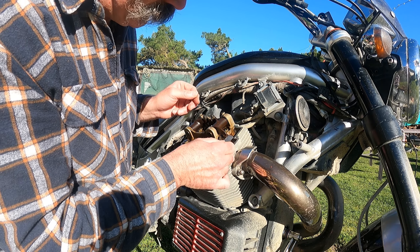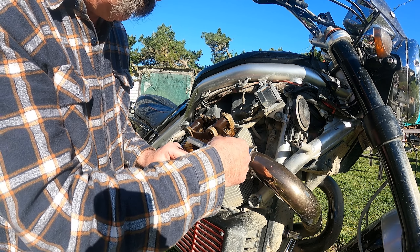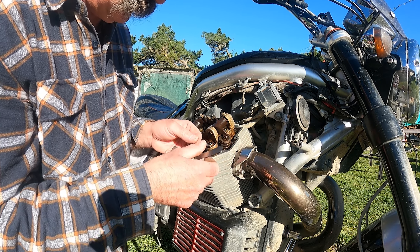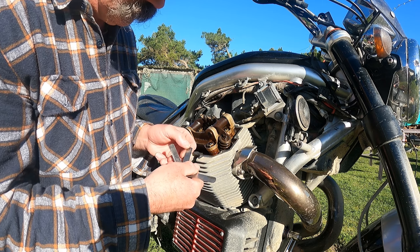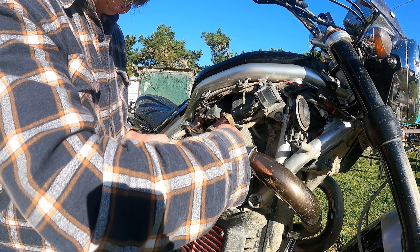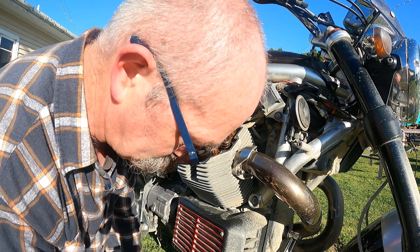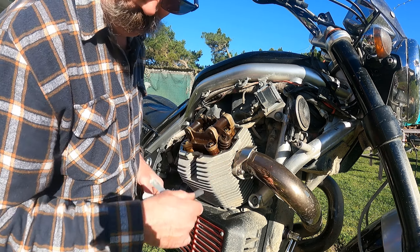Throw that in there — I think I actually did this only about 5000 k's ago. That's perfect, so that one is perfect. The exhaust valve I would say could be classed as too tight. It's in between 0.1 and 0.15, right in the middle. I'm going to say I'll leave that as it is — just make sure I'm in the right spots. Actually, we probably should make a slight adjustment there.